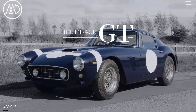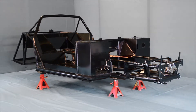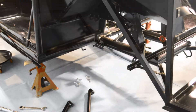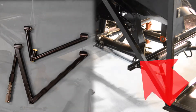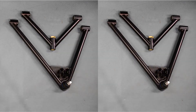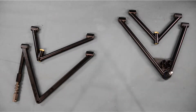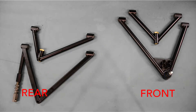So let's get started. Now that our Stage 1 kit chassis has arrived, it's time to start assembling our Mirage GT. We're going to start by attaching the wishbones to our four wheel arches. Each wheel arch has two wishbones, giving us a total of eight wishbones to attach to our chassis. Notice the difference in shape between the rear and the front wishbones, and be sure that you have assigned them to the correct wheel arch before beginning the assembly.